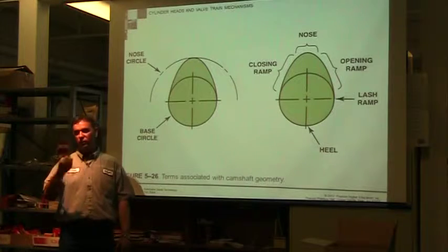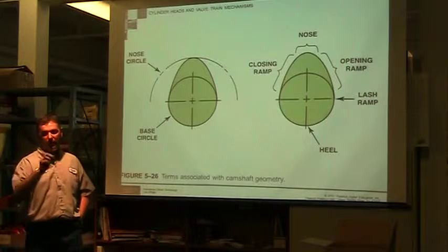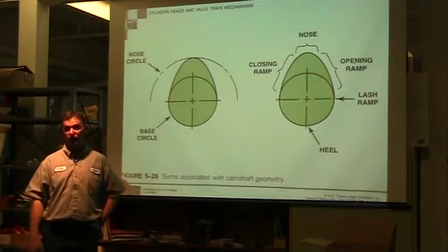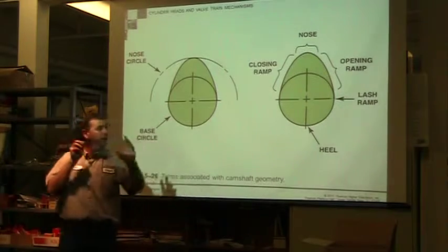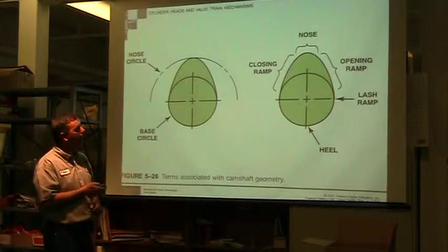And you had to be shifting then. It was amazing. If you were trying to race in that car, you would be playing with that 3,500 to 6,000 RPM range, and that car moved. It actually hydraulically moved the whole camshaft lengthwise so that you were pushing on a different cam lobe. That's how they accomplished it.